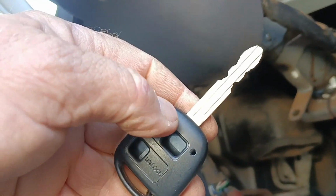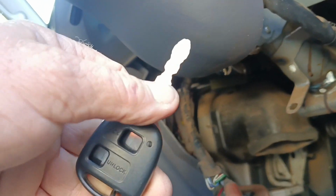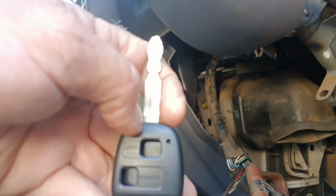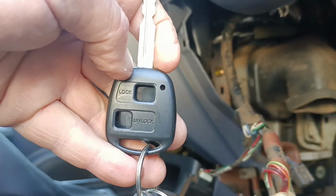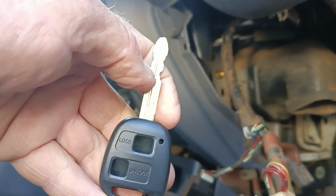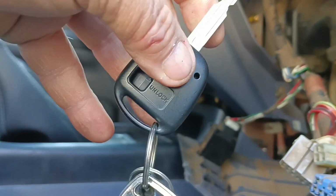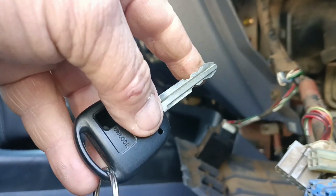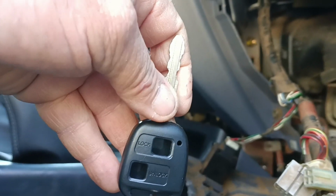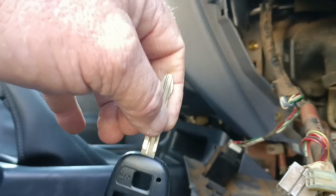Just on that, if you also have that factory cut blank somewhere and you need a new key made, most of these guys can read transponders and write transponders, so that's easy enough, but most guys cannot do a factory cut. So to have that, they can just do a normal key copy off that, it'll work and it'll give you a great key. But you don't want copies of copies of copies. So we've got masters, and we're quite happy with that.